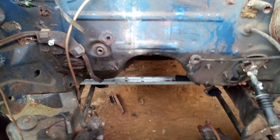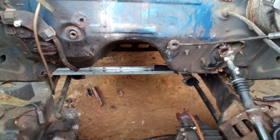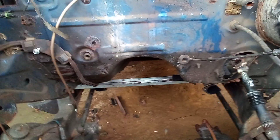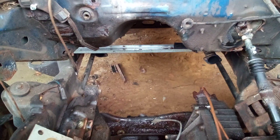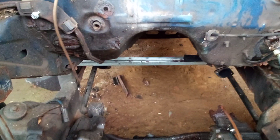That's a lot of room — that might be four feet. Let's get to doing some measuring here. That is a nice little tunnel that you can jam your transmission up into a bit. That 32RH fits in there perfect. You don't have to worry about cutting into the firewall or the floor on this car. You can keep your cables in the same spot pretty much — you've got to be careful that the shift cable doesn't get melted, so zip tie it up away from the hot thing. That crossmember down there I had to fabricate myself, and that's going to probably stay the same because I'm keeping the same transmission for this run.